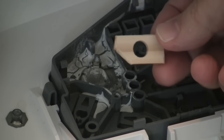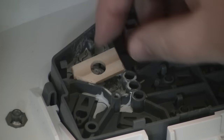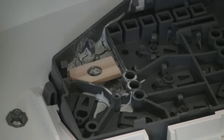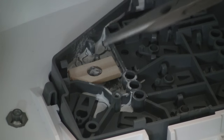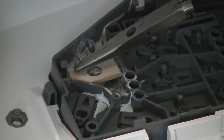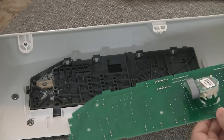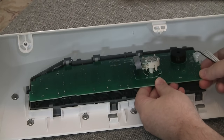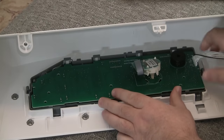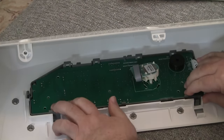Since acetone will unstick superglue, I put some acetone on a Q-tip to rub under the button to loosen the superglue and remove the button. I also promptly knocked the acetone can over and spilled it onto the plastic housing — it certainly discolored it but doesn't look like it did any harm. Attaching the circuit board back into the housing is easy. Simply put it in at an angle to seat below the tabs at the top and then snap it down into place.